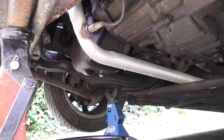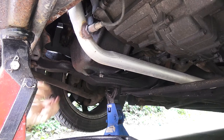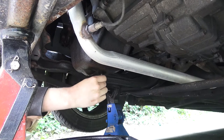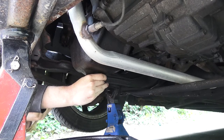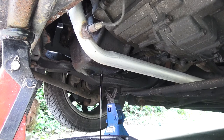I've got the oil pan under it now. I just need to loosen off this bolt. That's cracked loose. Now the trick here is to just apply a little bit of pressure upwards as you're unscrewing this, until you feel it sort of click over — so that's completely out now. Pull it quickly — it's the easiest way to try and stop getting oil all over your hands. You should wear gloves because oil is carcinogenic, especially used oil. You can see that's quite black, but I can still see through it, which hopefully means it's not too bad.